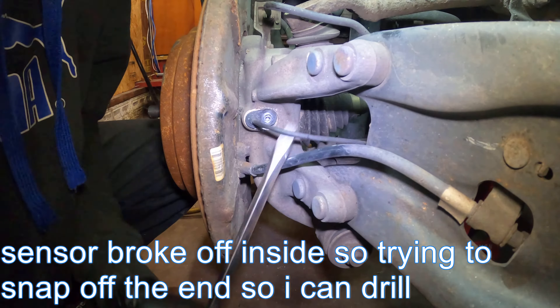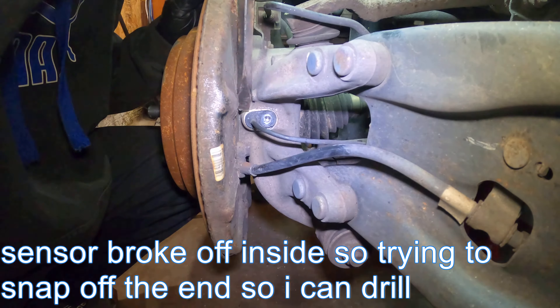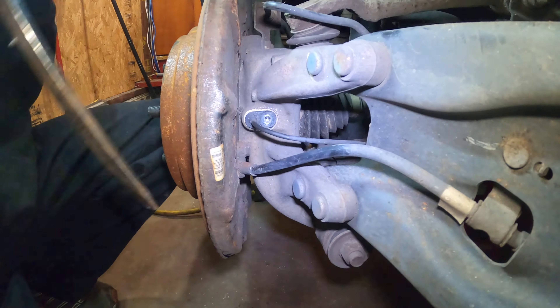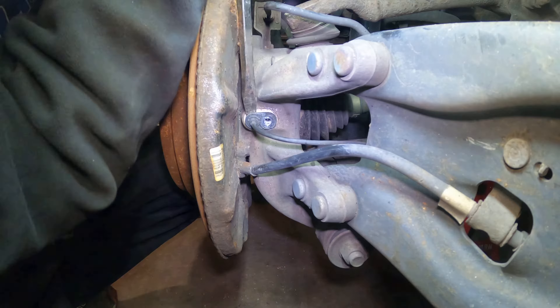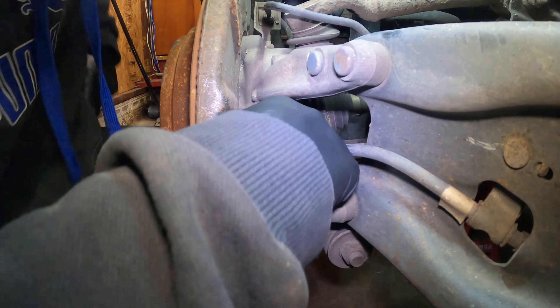This one pushes into the knuckle, so let's get this going first. You want to jack it up using that little notch right there. That's your next step — take off the five 22-millimeter lug nuts.